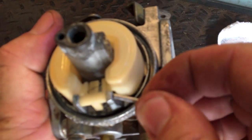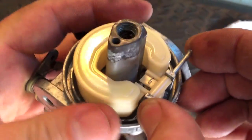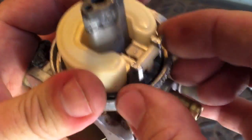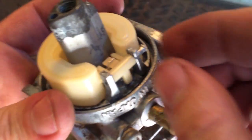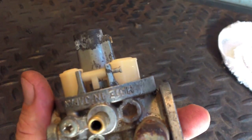This one just slides in. Some of them lock, some of them clip in — they're all kind of different. One of the things I noticed when taking this apart was that the needle valve was stuck, and that was causing the problem with this motor. But when you have it down that far, why not just go ahead. I'll get some pliers and push this guy in place.